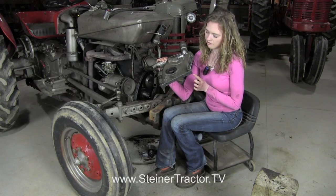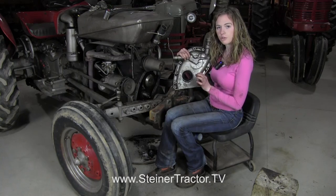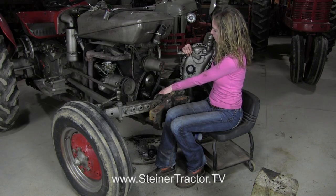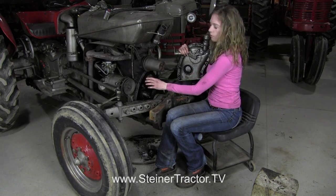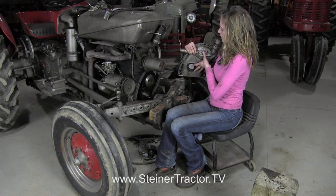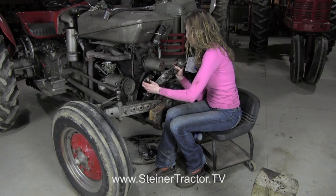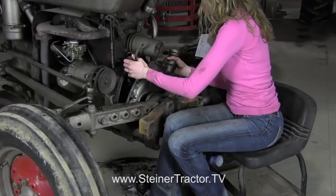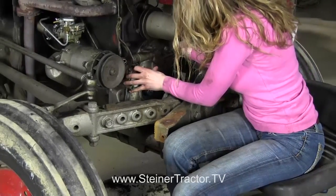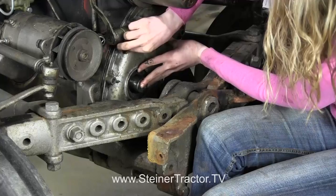My new seal is fully installed and you can see the felt cover there. The felt cover is just to protect it from dust so don't worry too much about it. On the bottom of my cover you can see that I have a lot of gasket material, and I also put some gasket material down at the bottom here too to ensure a really good seal, since our new gasket only covers the top and the two sides and doesn't cover the bottom. I was sure to use a razor blade and really get all remains of the old gasket completely removed before putting this back on. Make sure the rod's in place with the spring on, then the cover drops down, slides over, and goes on, and then one bolt gets started to work our way around.